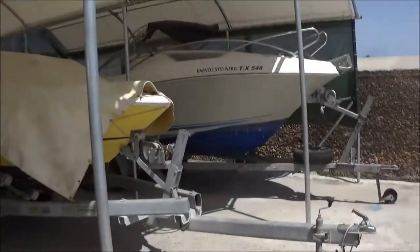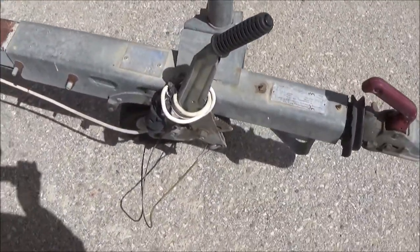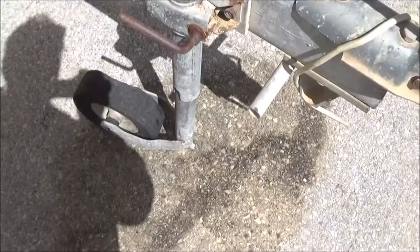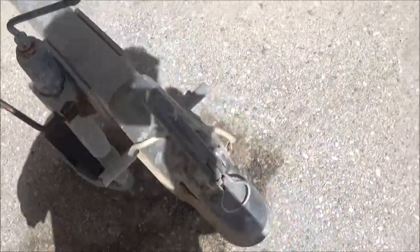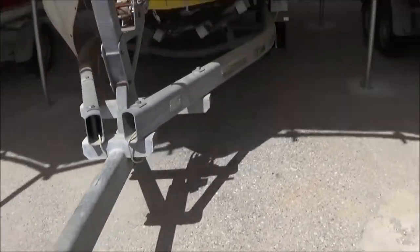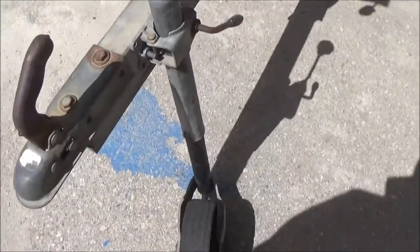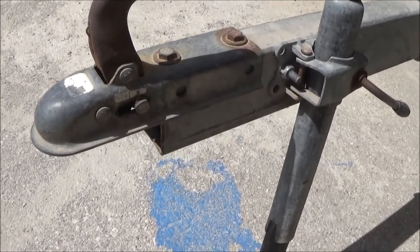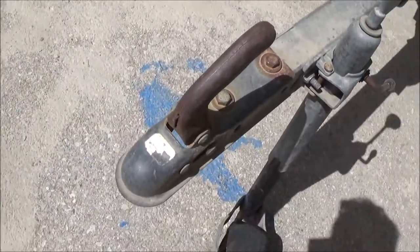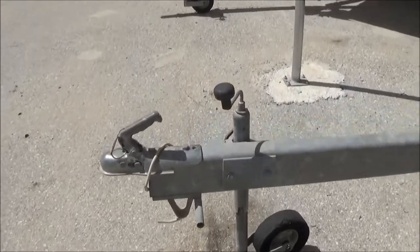Just to show you — most trailers are all similar. You can see all the different boats here and the mechanisms are pretty much the same. There's the one from the demonstration with a chain; this one actually has a metal wire — same function. There's your height adjuster shaft, same again. The only difference with this one is there isn't a chain. It's always good to have a chain or at least some sort of support, just in case the lever breaks and comes away from the ball.